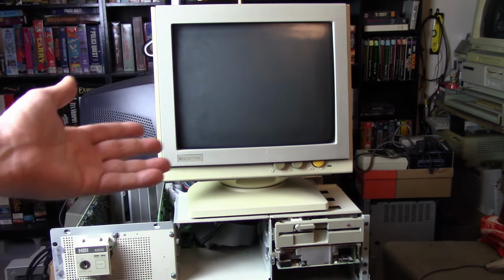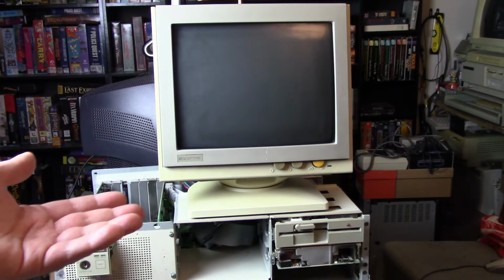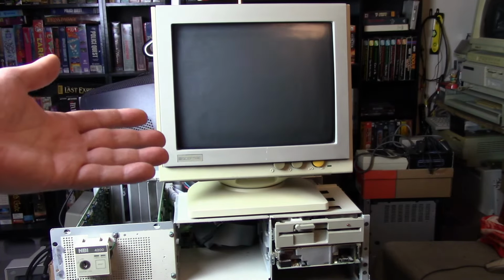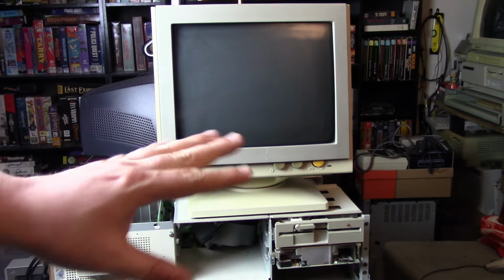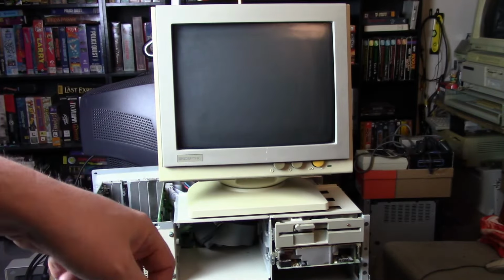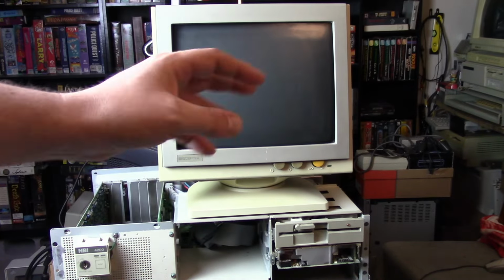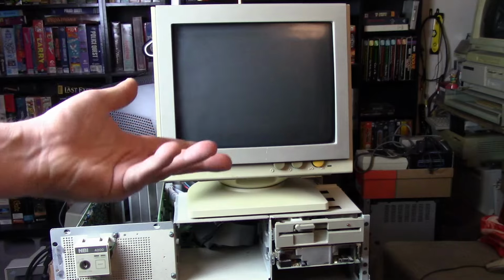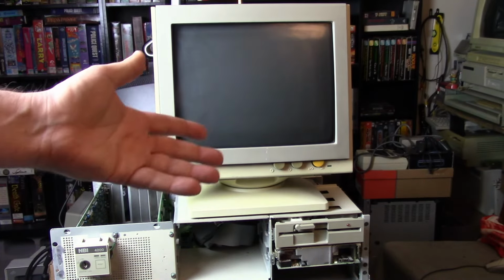Maybe there was an external battery at some point, which also brings up another issue: the machine doesn't seem to have a BIOS that I can get into. I've tried all the usual suspects, Delete on post, F1, F12, Control, Alt, different combinations. Nothing brings up a BIOS screen.